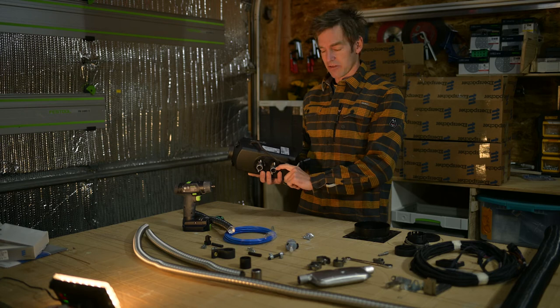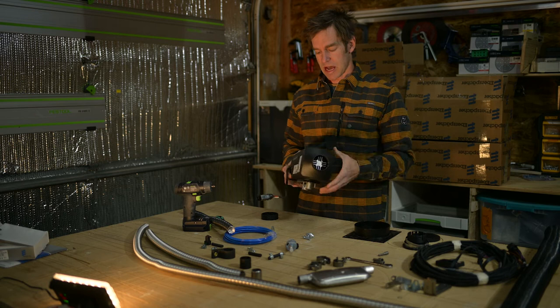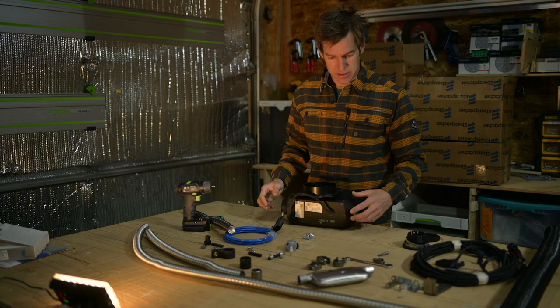This is your fuel line, so it's fuel in from your fuel tank. You get this little cap where the fan is. You'll see here's the heat exchanger, where the air blows out. Here, where the fan is, we'll cover this, it just clips on there, so that mice or anything doesn't go in there and kind of ruin your fan. And we're just gonna pop this in here. There we go. We're gonna pop on some bolts.